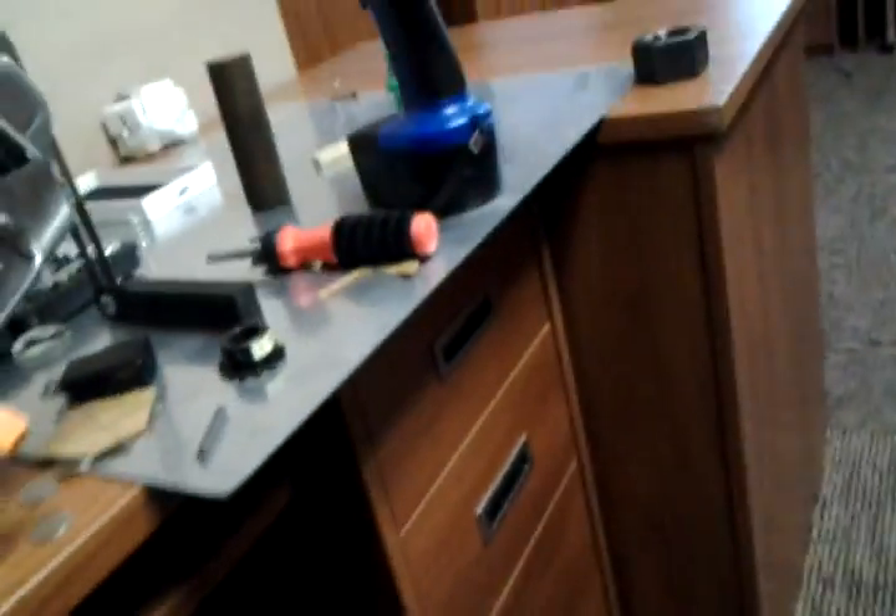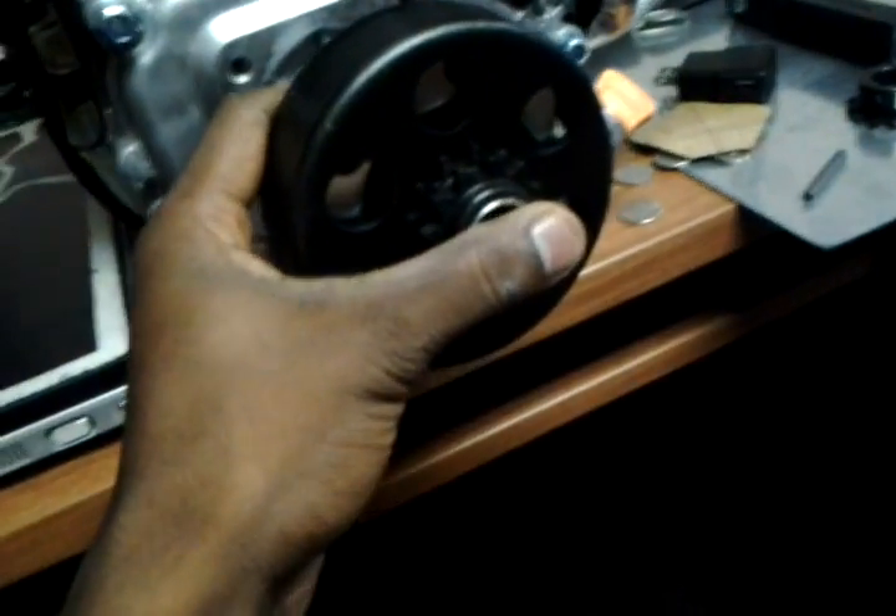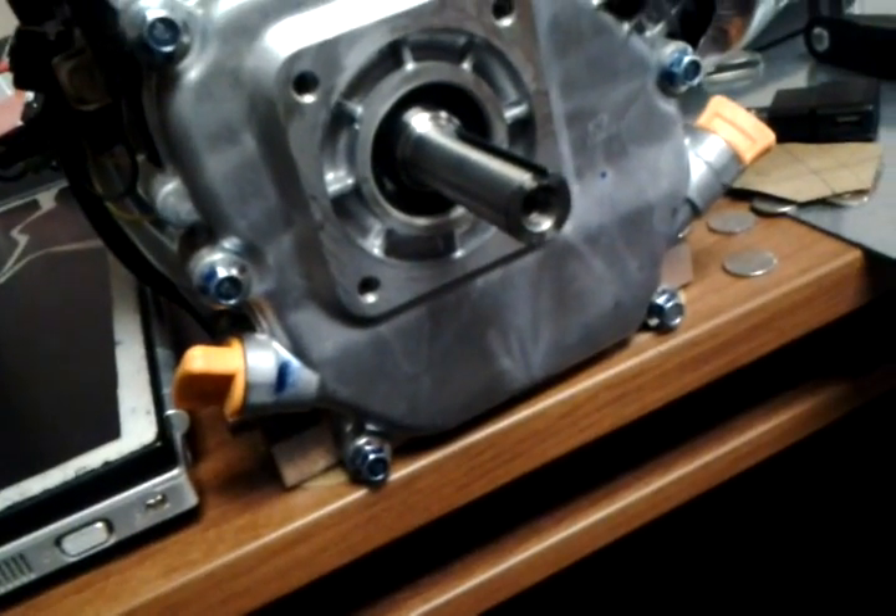So when you go to install this on your own go-kart engine or whatever, keep in mind it's 1.9 inches. This hub piece doesn't push all the way back to the ring — without the keyway it sits flush against the back, maybe with just a slight 1/16-inch gap. But with the keyway, it doesn't go all the way — you have maybe a quarter-inch gap.